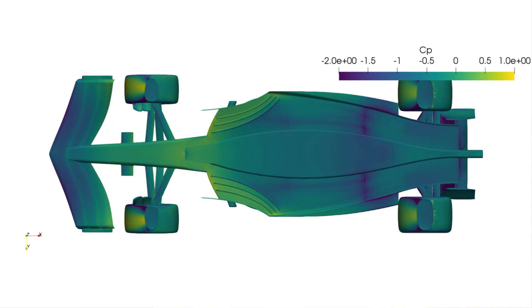I've prepared some CFD with a general 2023 Formula 1 car to help illustrate some of these interactions. But firstly, to understand why we might use this geometry, we first need to understand what the flow field is generally doing in this region. Now at the point of the floor kick, we generate significant suction.